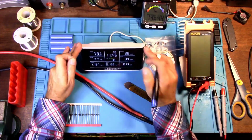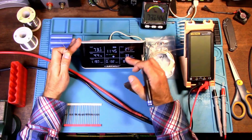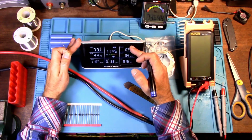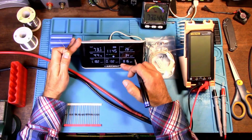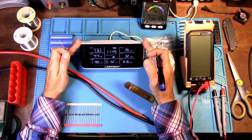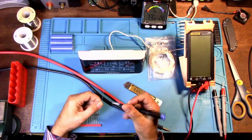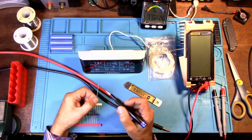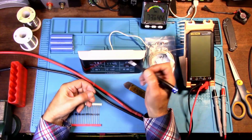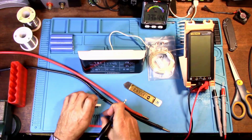Okay, so with this device and with devices like this, more than likely what charges the battery also needs that voltage to come back to the same location to power the unit if it's running on a battery. Now some devices aren't built that way, but this one is. I've already looked at that. So a diode would not work in here simply because the voltage would go to the battery, but then there would be nothing coming back from the battery to power this.